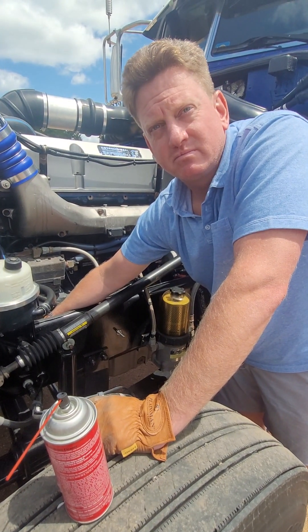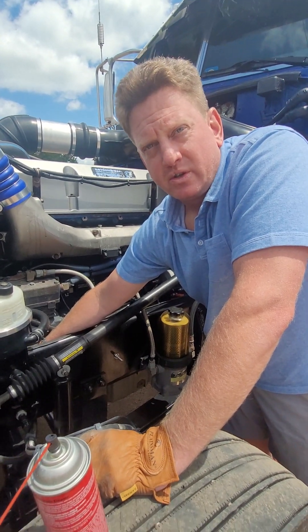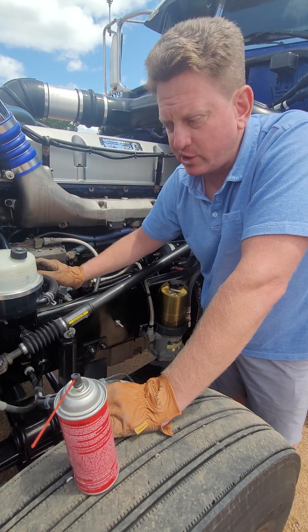To summarize everything — if it's crank no-start, where would you check? If you have a check engine light with a crank no-start, this is your first step: check your timing sensors.